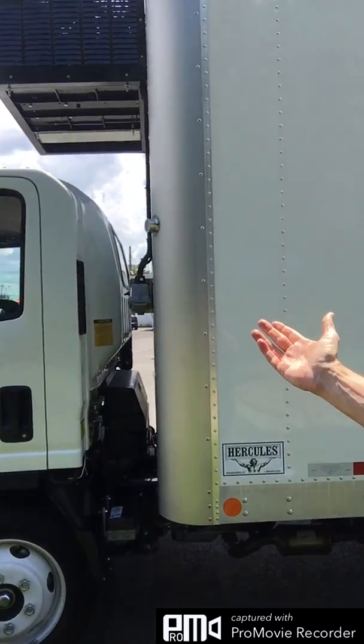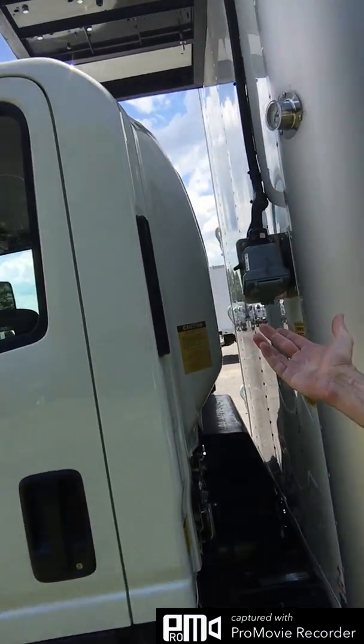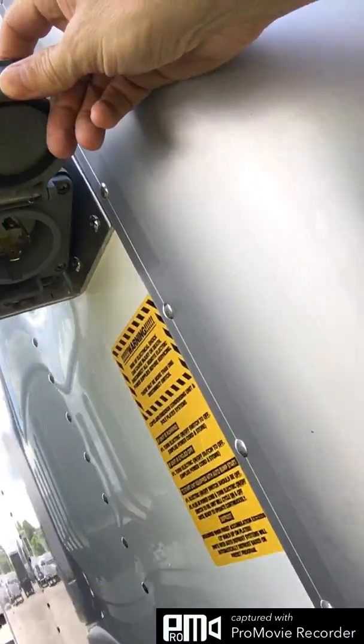Well, in a cold plate you don't have any of that. What you have is cold plates, just like it says. You plug it up the night before — as you can see right here, this looks like your typical electric standby block. This particular one we engineered for 230 volt, three phase; other options are available. What happens is you plug it up at night, it cools off the box and cools off the cells. This particular application we're doing negative 20 degrees because he hauls frozen food. When your guys come in in the morning, the box is cool and they're ready to go. As the day goes the temperature does rise, which is why we want to make sure that when we spec the body, we spec it right for you. We had the Hercules representative come out to see the customer and make sure they got exactly what they were chasing in the application.